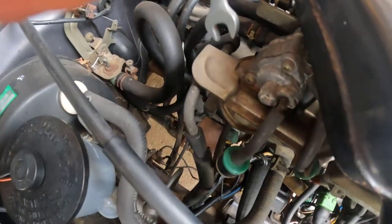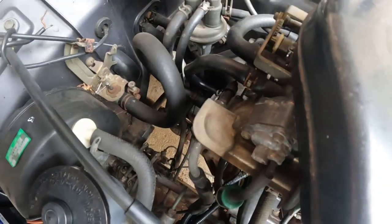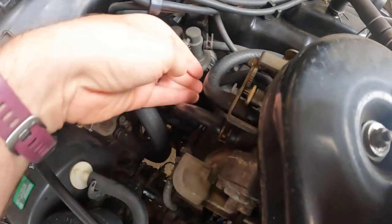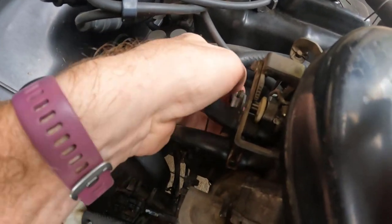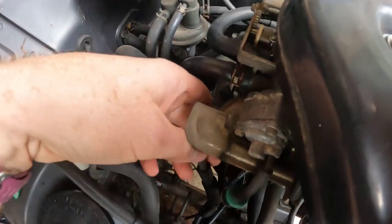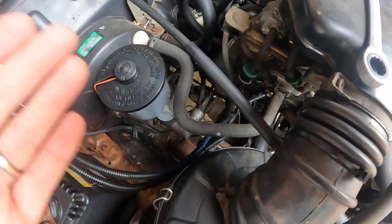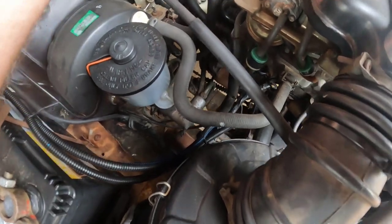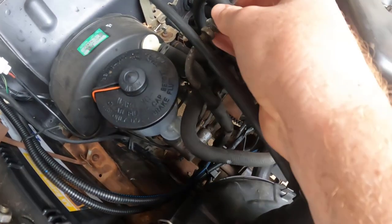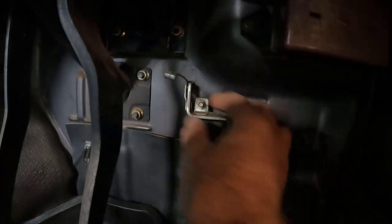The first thing is to remove this lock nut — 12 millimeter — on the carburetor. And there we go. Then unhook it here from the end. That's actually easier than I thought. Just remember how it is located — ideally you would place the new cable next to it so you don't lose track of where it runs. But it just goes straight from the carburetor all the way to the firewall where it goes in. I'm going to press in this cable to get some slack on the other end — it's very simple, you just pull on it.